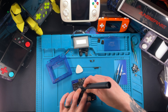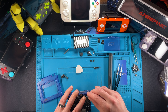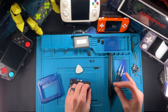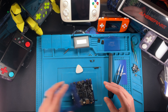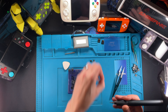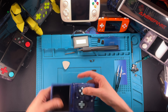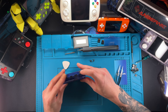Put your last couple of screws back in. Hold that PCB back down and then put your shoulder buttons back in. There's just one post on each side that holds your L1 and R1, and then L2 and R2 are just balanced in front of the micro switch, which is why they rattle. I'll probably do a mod video on that later. Put those last four screws in and test all your buttons — make sure everything's working. If something is too tight, take the buttons back out and lightly sand the back of them to loosen them up.